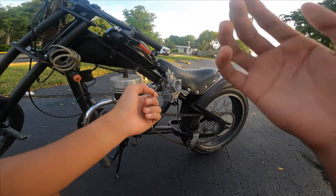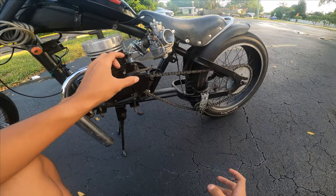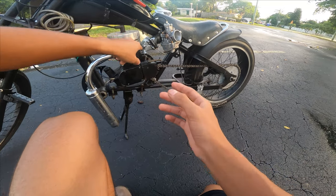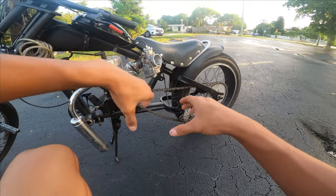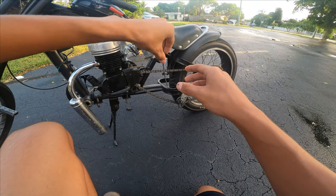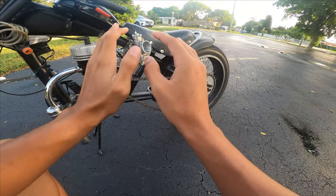A gasket maker. I went and got it and made sure that the surfaces were true. So basically you get sandpaper and you get this black piece and the reed valve, and you put it on the sandpaper and scrub it until you see there's no shift, so that way they're truly, truly dead center flat. They weren't. They were actually really uneven.